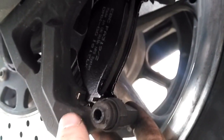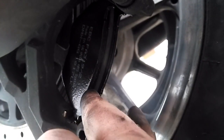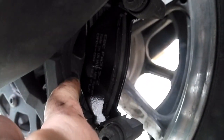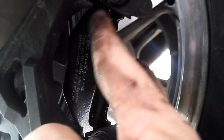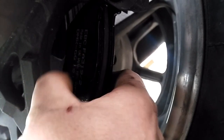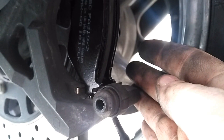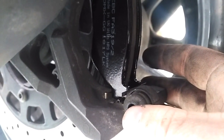Just put the new pad on — just like a car. You got this hardware here, so you just slide them in. We want this concave end facing outward and the convex facing inward. Here you can see which way they go — this is puffed out and this is half-mooned in. It appears they're both the same so it doesn't really matter what side they go on.